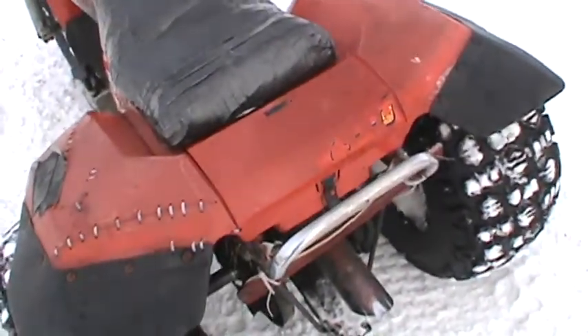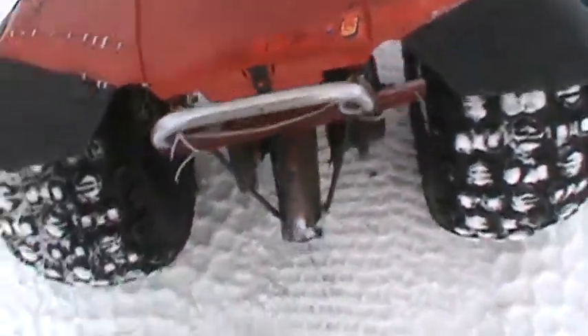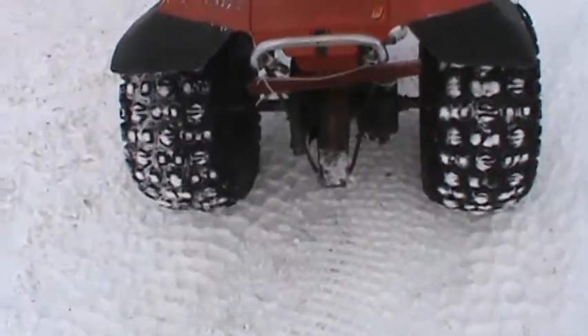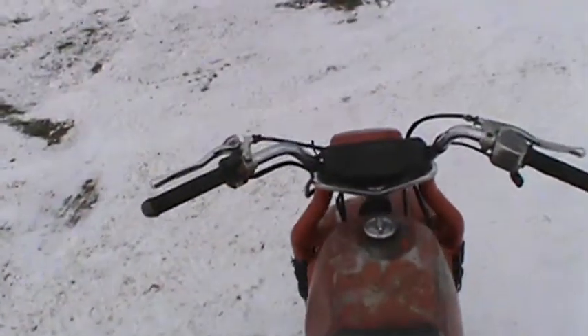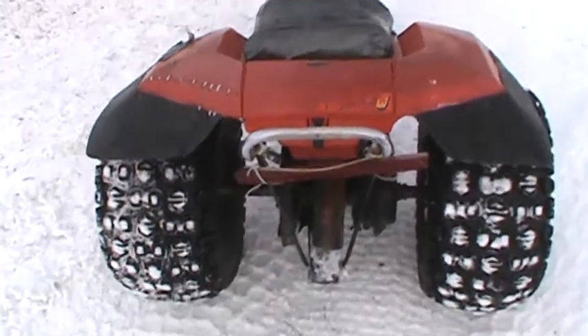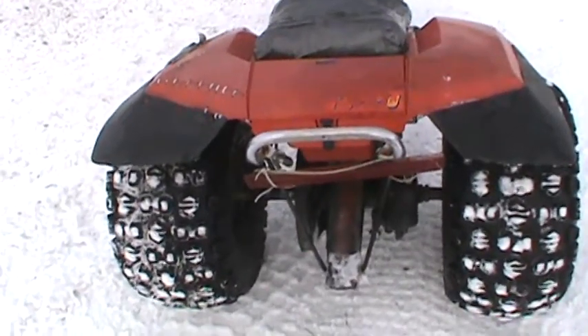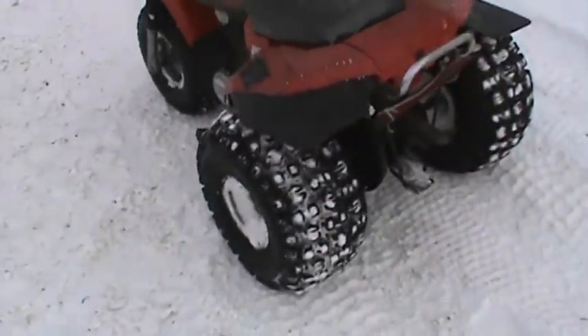Oh my god, I'm so sick. Anyway, this light bar is kind of screwed — it's got a few resistors that burnt out because this thing has no voltage regulator, and it got a little bit of a voltage spike when the headlight wire came loose. Some of those LEDs are still working though. I also lost the bridge rectifier — I forgot to tie it up and lost it somewhere in the snow. I'll probably never find it.